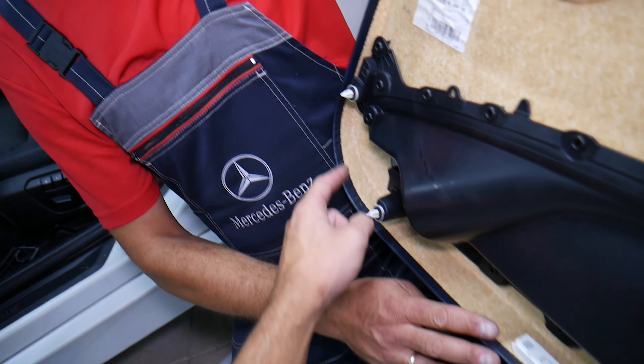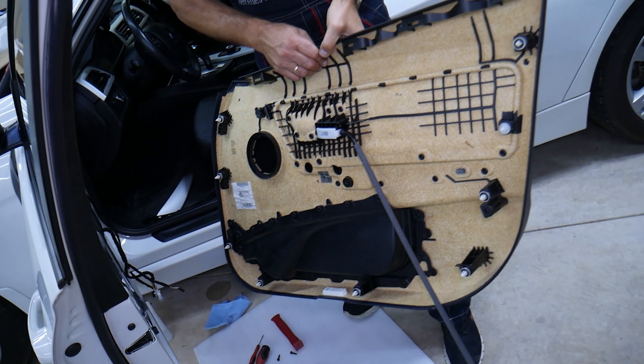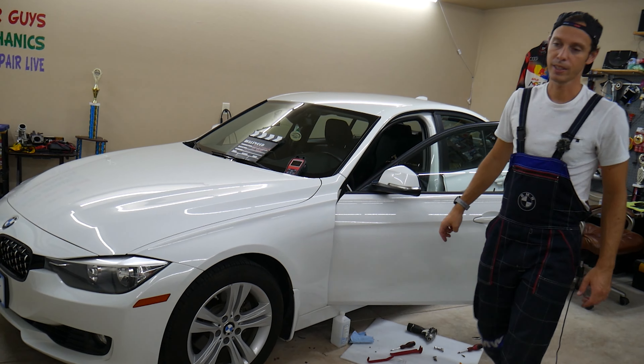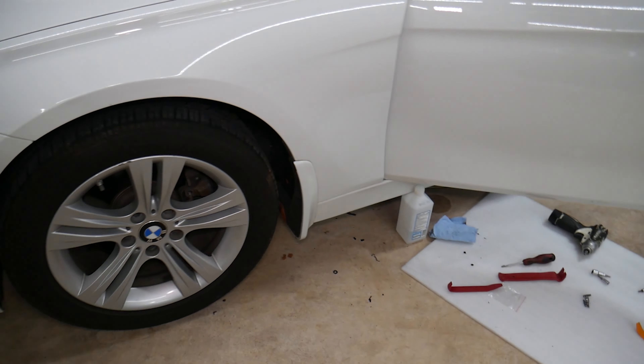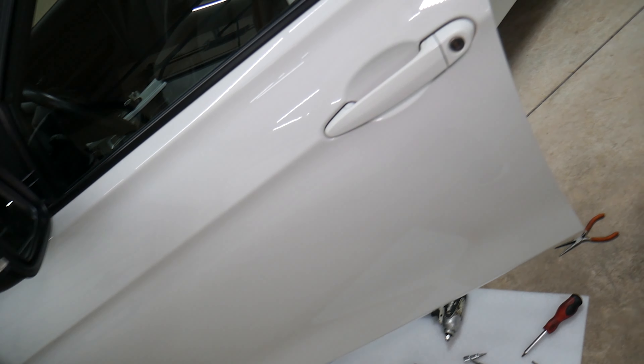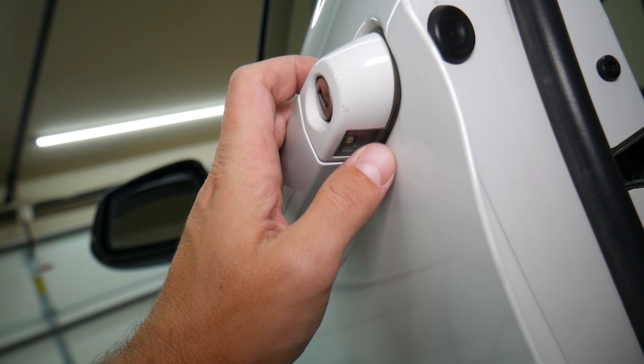Now watch the clips — sometimes you're going to get those rubber bushings and you need to install them so the panel doesn't vibrate and you don't have noises later. If any clip comes off, just slide it out. If it came off and it's stuck on the door, remove it and push it back on the panel. If it's broken, just replace it with a new one — we'll put a link in the description where you can get one. Let's explain where all the clips are located so you know what to expect from the back side of the door panel.